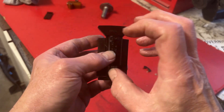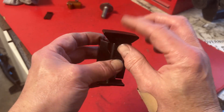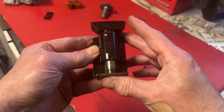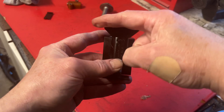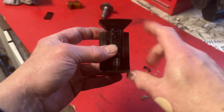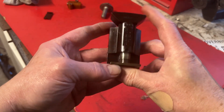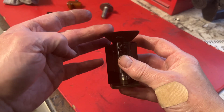Yours is plastic at the top — it's metal — but the rest of it is actually an idler. There's no tensioning on the top of the right hand side tensioner; it's actually on the bottom. The chain comes over here around the cog underneath, so the chain slack is taken out by the piston at the bottom. The top is just, as I say, an idler.